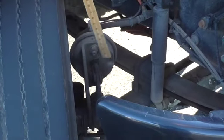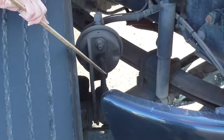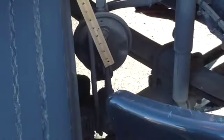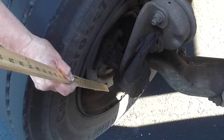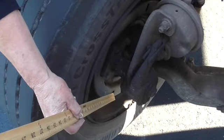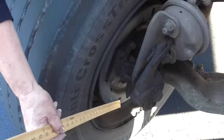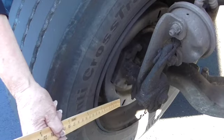This little fingerling right down in there is the pushrod. The pushrod works along with the slack adjuster to allow air in and out of the chamber. Any time you see a cotter pin like that one right there, say the cotter pin is in place. If I were to pull the slack adjuster by hand, it cannot have more than one inch of travel. On the inside of the tire, this cover is called the dust cover — it has little slit holes. You don't ever want to see anything coming out of those slits, such as steel shavings from the brake drum or anything that looks like cotton candy, which could be your fiberglass brake lining starting to come out.